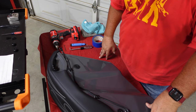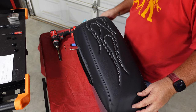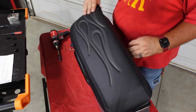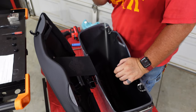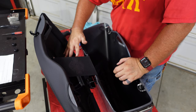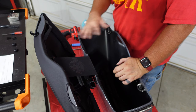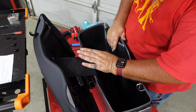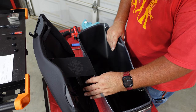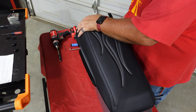I got the other side done and pulled off the left side bag. I want to update one thing I discovered when drilling the other side. For those of us with larger drills, I found that if you wait to put on the hinge cover, the cover will lay back a little bit further and you've got a straight shot to drill your hole. My recommendation is to let the bag lid hang out against the cardboard — that protects it and gives you a straight shot for the drill so you don't have to go at an angle.